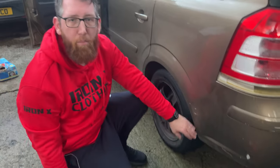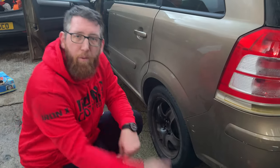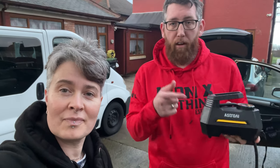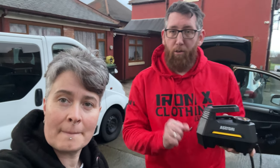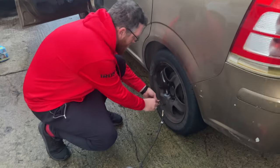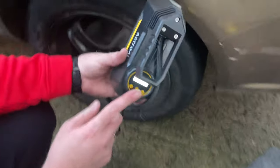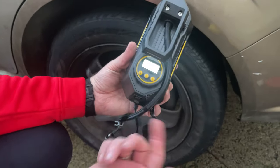And that's the tyre plugged up. Then all you have to do is pump it up. This is the tyre inflator we use — again, links in the description on Amazon, so give that a search and get this. Just plug this in and connect it on like so. It reads about 12 PSI so we turn that on.